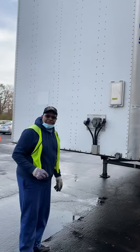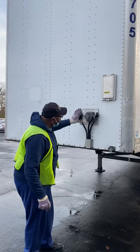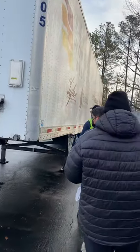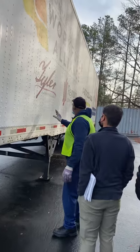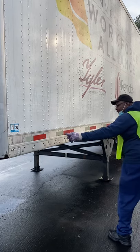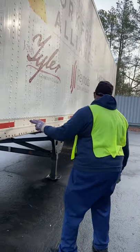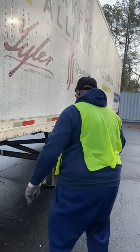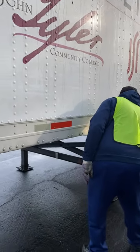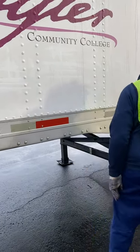Here, we discussed the gladhands — they're connected. This is the electrical box attached to the trailer side. This is the side of the trailer — it's not cracked or broken, not missing nuts, bolts, or screws. No holes that would allow elements to destroy the frame. We have DOT reflective tape — it's not cut, cracked, dry-rotted, or peeling, and it runs the full length of the trailer. Under here we have the undercarriage — cross-members, floor, and frame. Not cracked or broken, not missing nuts, bolts, or screws. Nothing is missing and there are no holes that would allow elements in to destroy the frame.